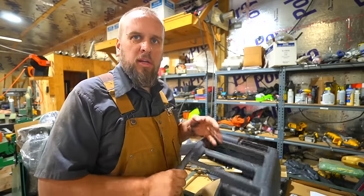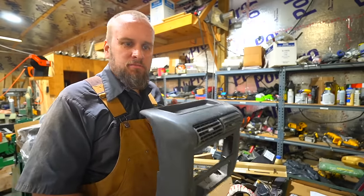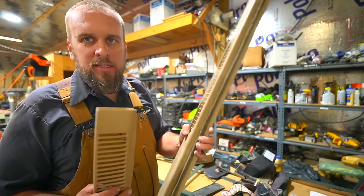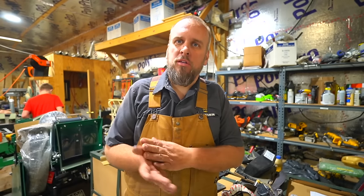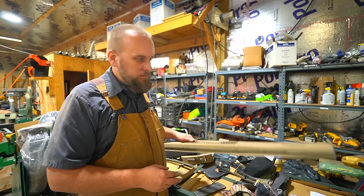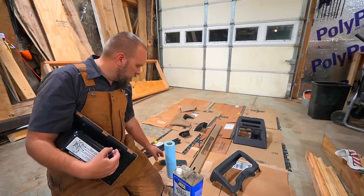While we're working on that, we're also going to be working on the dash. I hate these interiors that these Jeeps had — mainly I hate this brown. Some of the middle pieces were a matte black or a darker gray, but the majority is this brown or tan color, so we're going to paint all of this to a new clean black. We've got some special paint products for that but it has to be clean, so first we're going to wash it with soap and water, then clean it with acetone, then use some adhesion promoter.